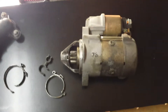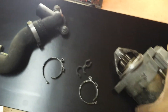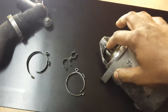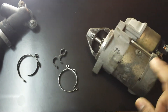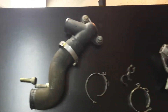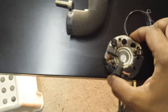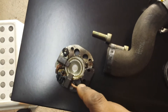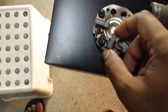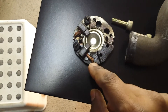I finally got the starter motor out. This is the faulty starter motor and I've opened it to see what was causing the issue. This gear is supposed to be down there — I've taken some of the bad components out. The reason it's faulty is because on the base it has a plate with two carbon connectors that power the armature, and one of them is broken from the base. Because it's broken, it was creating a short circuit at the back.